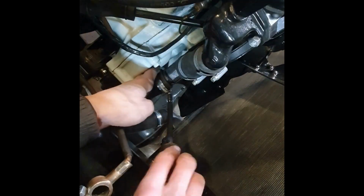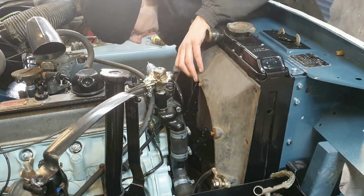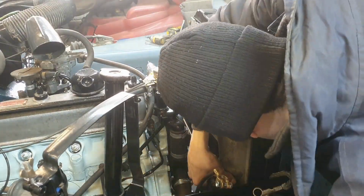It's the bottom hose, and I cannot recommend strongly enough to just buy a pack of genuine Jubilee clips. They are much better than any of the rip-offs. They just break so easily, the rip-offs. You can't get anywhere near the clamping tension on them.